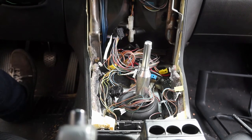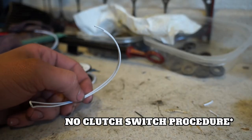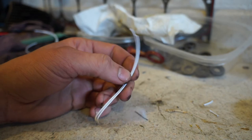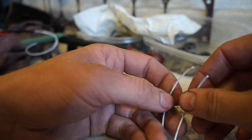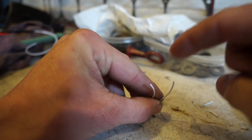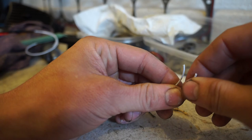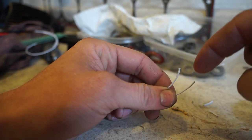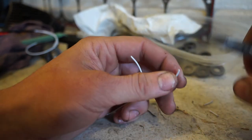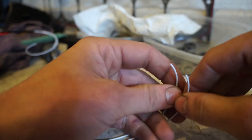We're all wired up - as far as wiring goes, that is it. The clutch switch should work and the reverse lights should work. From here we basically put the center console back together and the whole manual swap will be done. This last section is for those of you who are not going to be running a clutch switch. We're going to pretend the automatic transmission harness is right here with pins one through eight. As discussed in the test drive video, we jumped pin five and pin seven to get the car to start and run. So we're going to cut the wire for pin five and cut the wire for pin seven.